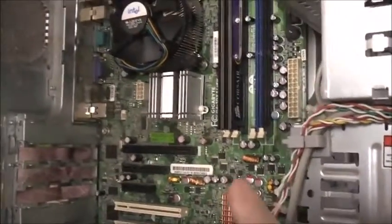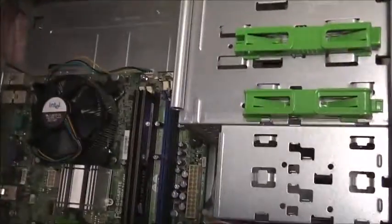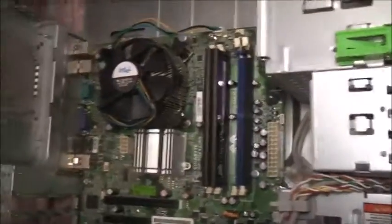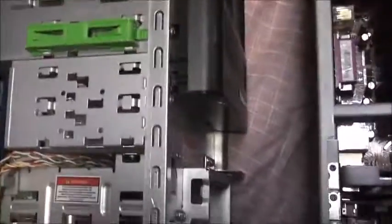So 2 gigabytes of DDR2, which I might have a good search for on eBay, because the local PC shops are just generic brands. I can still get relatively good quality DDR2 RAM on eBay quite well. So I'll fill that completely up with the highest speed of DDR2 this board can support. Put the Xeon back in it. Put the sound card and the GPU in there on that board. I might rip those USB ports out, but USB 3 upgrade PCI cards are cheap enough on eBay.